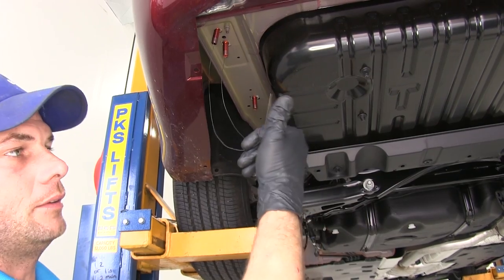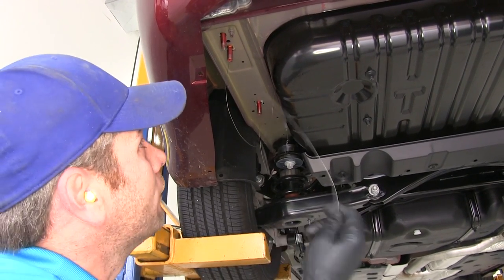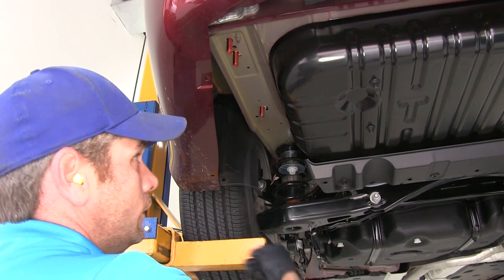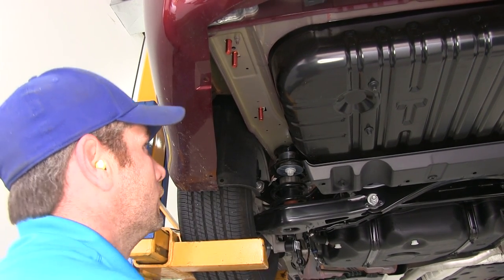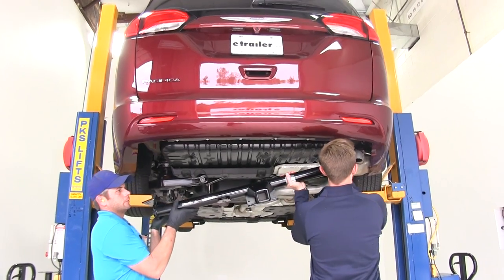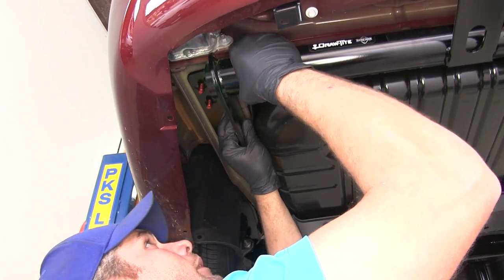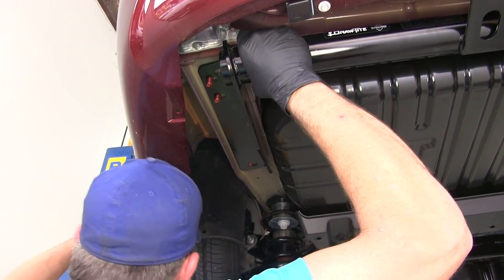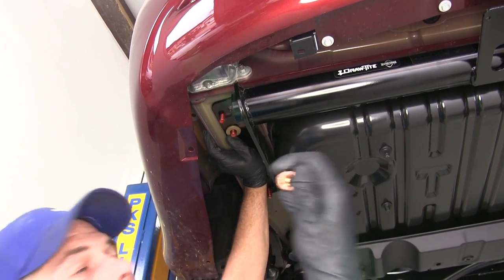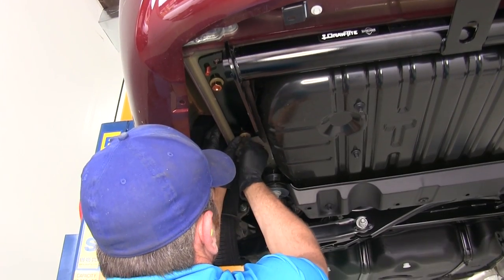Now we have got our pull wires attached here to our bolt still. You can leave those on, put them through the appropriate holes in the hitch, and then use these to guide it up into place. I find it easier to do it without them simply because then we do not have to try to hold the hitch up and then remove the pull wire — but it is up to you. If you are going to do it this way, you definitely do not want to push the bolts back up into the frame. With the help of an extra set of hands, we will want to get the passenger side started up over the exhaust first, then raise the driver side up into position. We want our carriage bolts to come down through — the first thing we will do is place on a conical tooth washer with the teeth facing up towards our hitch, and then thread on one of the hex nuts. We want to be sure we get one started with about three or four good turns and can let it rest there while we get the other side going.